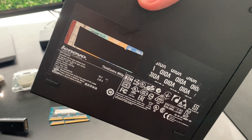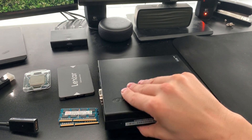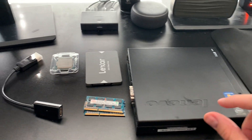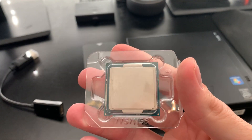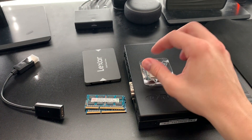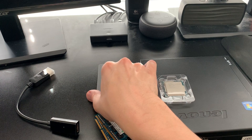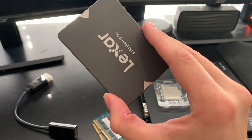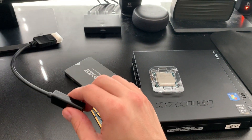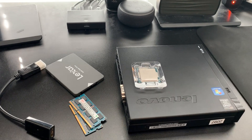I'm going to be installing Windows 10 and probably a dual boot Ubuntu on here. It looks like a cool little PC — I've seen a few people use them online. A lot of people put a higher-end i5 or i7 CPU in, but those are still pretty expensive on eBay. I got this one for like $12 — it's a G3240T, a 35-watt CPU. I'm throwing in four gigabytes of RAM. This is just a 128 gig SSD I got on Amazon for about $13 — Lexar brand. And I have a DisplayPort to HDMI adapter since we plan on using this on our TV in the living room. Let's take it apart and I'll show you what it looks like.